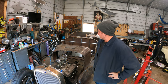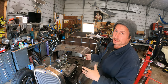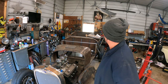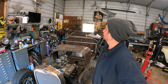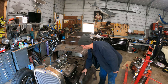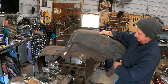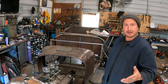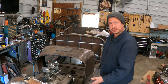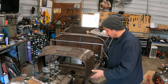We spent an absurdly large amount of spare time and a ton of spare money getting it here too. It's kind of like purgatory — a little bit like Sisyphus pushing the rock up the hill. Right now the cowl has no structure, which is not what it's supposed to do. That is because we removed the firewall so that we could slide the cowl over the motor the way that we needed to. After all, we're putting a much longer and wider motor in where there used to be a much shorter and narrower motor. We have a small block Chevrolet V8 where the flat Ford used to be.